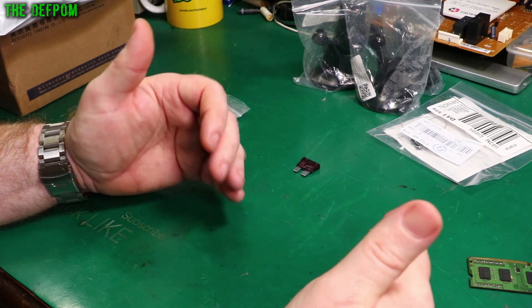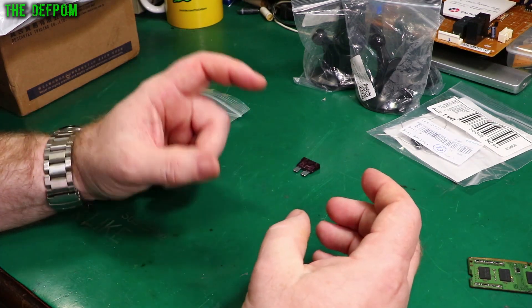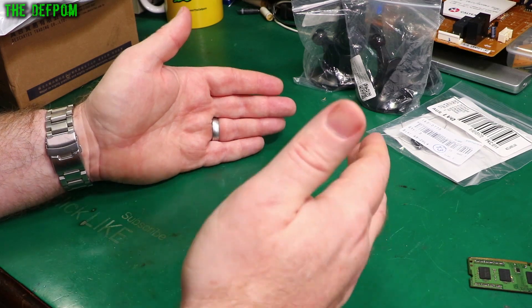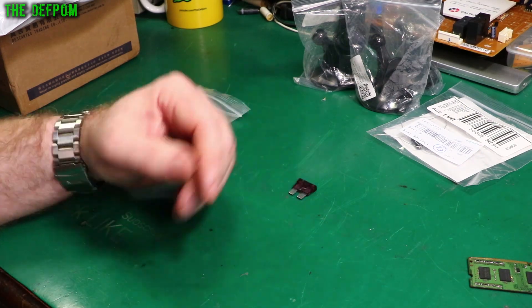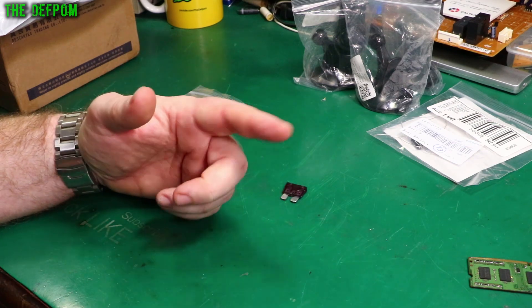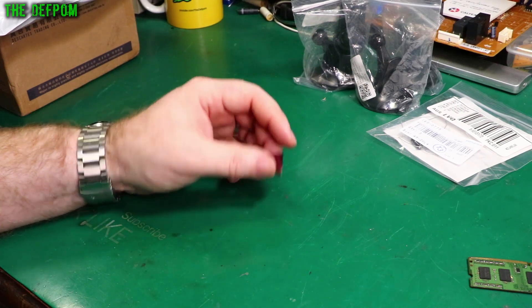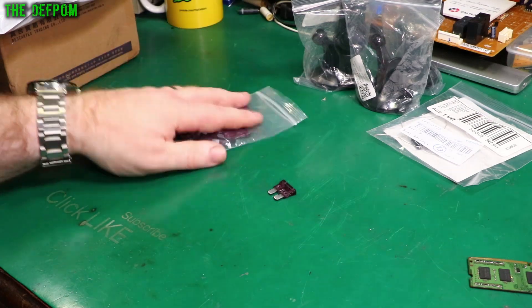In the other state, I have a direct link between the vehicle battery and the motorhome house battery. On the vehicle battery end I've got a thermal cutout rated at 40 amps — it's got a bimetallic strip that disconnects on overload. On the house battery end I have a fuse block with a 40 amp fuse. If there's a large brief high-current event, you can actually blow this fuse before the thermal overload activates, because obviously a thermal overload takes a little time to work. I've blown a couple of these fuses and I only had a two-pack from the local distributor, which are really expensive — that's why I got these.